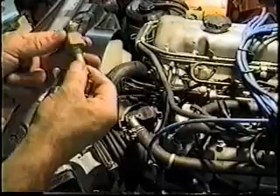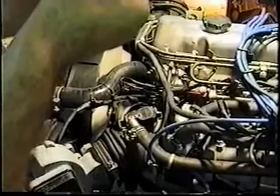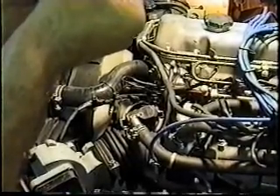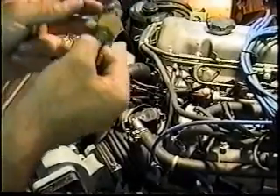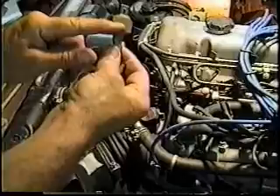Above a specific temperature — and it is written on the side of this one — this one here says that it is 19.5 degrees Celsius, nine and a half seconds. So at 19.5 degrees Celsius this will stay on for nine and a half seconds.